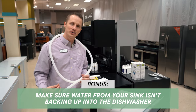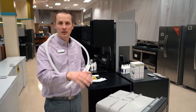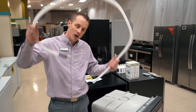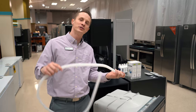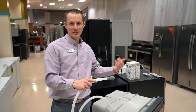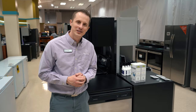A final tip: make sure water is not running from your sink back into your dishwasher. Sometimes a sink backup causes water to overflow and run back through the holes into the dishwasher, leaving standing water inside. To prevent this, as the drain hose runs underneath your sink to the garbage disposal, make sure some portion of the hose rises higher than the connection point on the disposal before coming back down. This high loop means that if water overruns the sink into the disposal, gravity will keep it from flowing back up into your dishwasher.